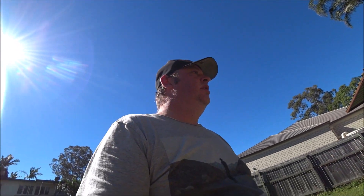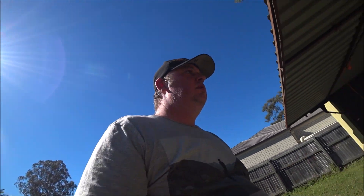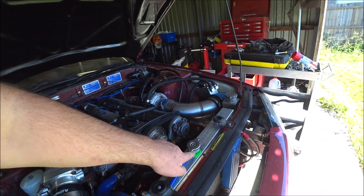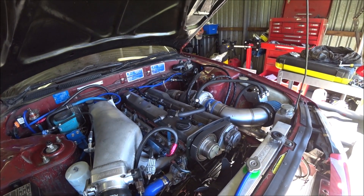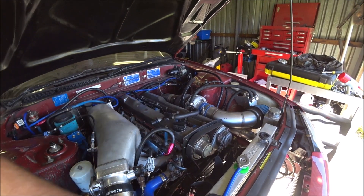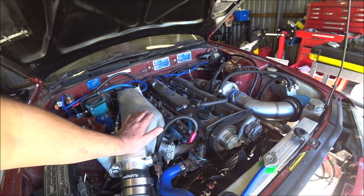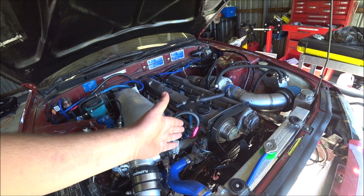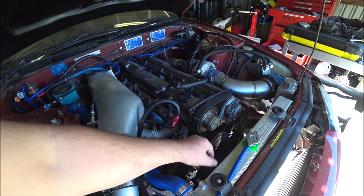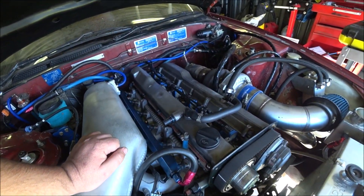What I'd quite like to do now is let it get up to operating temperature. Because it does run on ethanol, it really needs the heat to vaporise the water off that gets drawn into the fuel, so I'd like to see it get a full heat cycle. We do still have a misfire. I got it right up to temp, then I noticed the temp gauge actually started dipping — you can see we've got a coolant leak, it's actually the cap that's leaking. I shut it off as soon as the temp started to dip because the concern is air bubbles combined with a bit of leak could mean we're getting hot spots. If the coolant temperature is going down it doesn't mean it's not getting hot — it means there's air at the sender and not coolant. I've also got belt squeal because coolant is dripping down and the fan is spraying it onto the belts. We still have the misfire.